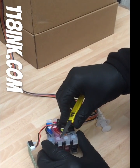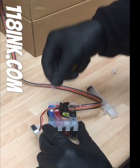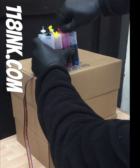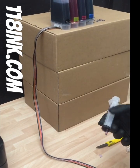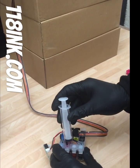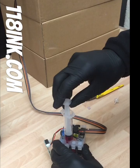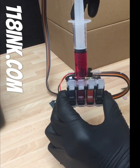What we do then is remove the plug here — this plug for the magenta — we just remove that nice and gently. As soon as you remove this, the ink should start to flow downwards. You'll get syringes with your kit, so you put your syringe in here and pull up slowly. Immediately it starts to flow and fill up, so the ink lines are primed.